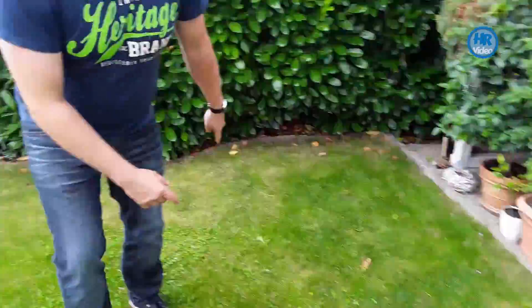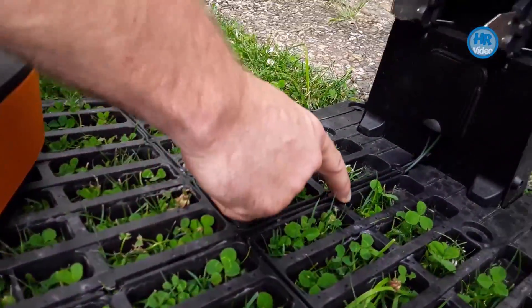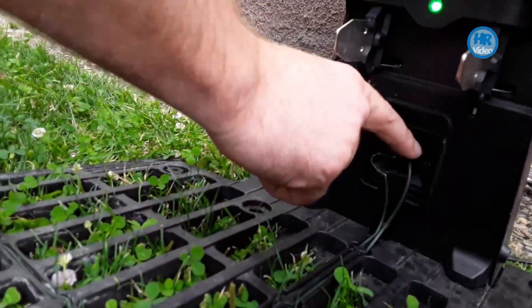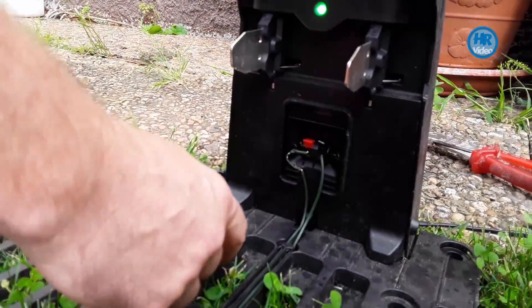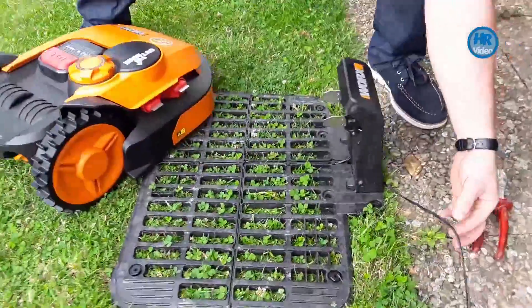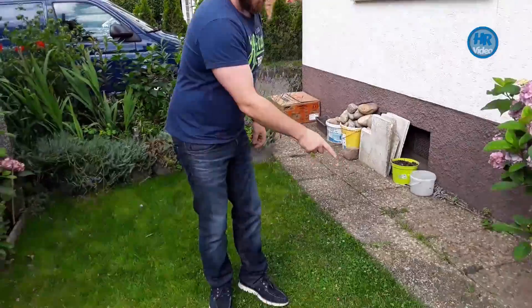It will go around the perimeter of your garden, all the way around, back into this groove on your loading station and up into the right side. You can see how it's fitted — you have a red and a black. Make sure one end of the cable is in the black and one end is in the red, and this will create your circuit. On the back of the loading station you have a power cable — connect it to power. Create your cable around the garden, your perimeter, creating the circuit. Now we have power to the charging station and we can tell the robot to start finding the perimeter.